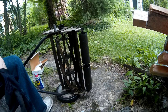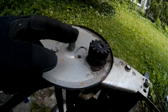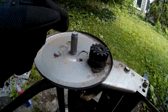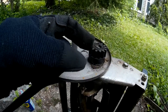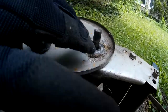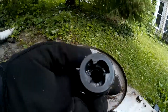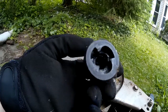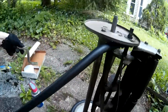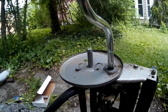And here's the trick. In the instructions it says be very careful because underneath this pinion nut is a pawl, P-A-W-L. All a pawl is, is a very short piece of metal. When you take this off, we're talking about this little piece of metal right there, and that turns this gear. Also, this crank handle fits over top of that pawl, like so.